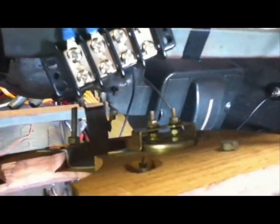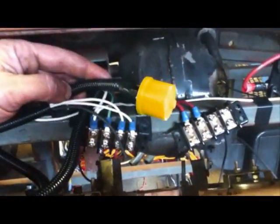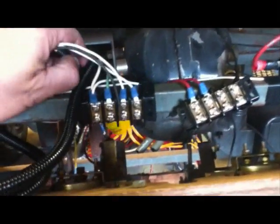Oh, that old switch on the bottom. This one. After testing it with a meter, it's junk. I gotta get another one. I gotta wire gauges. There's still a whole bunch of things. My flasher hangs down behind the dash. So if it's ever a problem, you just unplug it, put a new one in.